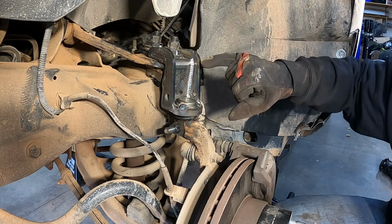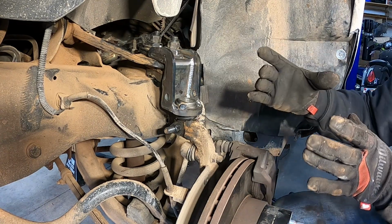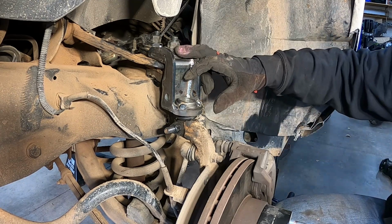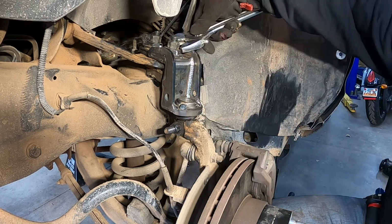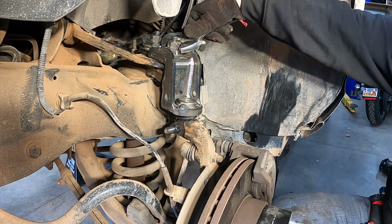As you tighten those down, you want to make sure that under here you don't have a gap, because if those cam lobes aren't sitting into those pockets correctly, it'll bind up on this and you'll hurt stuff. If these are spinning on you, you can hold that lower section with an adjustable wrench right there so that your marks stay in the right place.